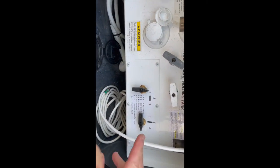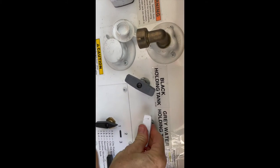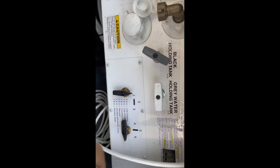I'll show you a little view here — I couldn't pull these out at all before, and now I can pull them out and push them back in. For maintenance I'll use drain valve lubricant — I'll show a link below. Another great addition I've always used is a clear cap. That way you can tell if something is filled up in your line and avoid an accident. And this clear extender is like a lifesaver when cleaning out your tanks — you put it on before your hose and you can tell when you're done because the water runs clear. That's about a $7 product and well worth it.